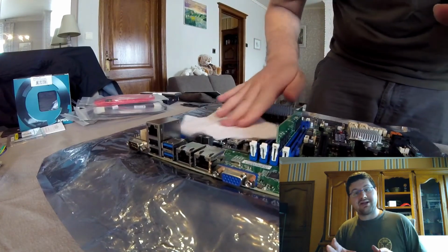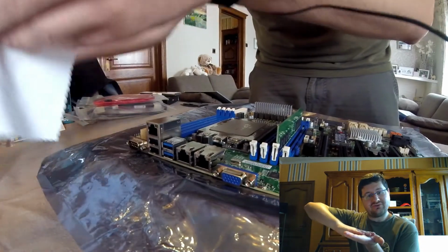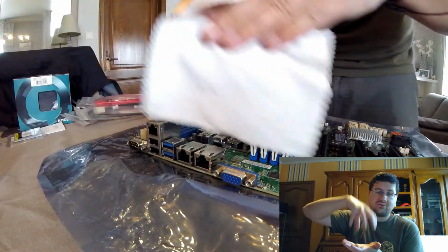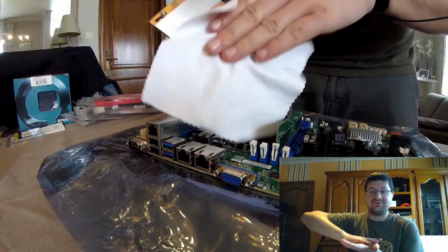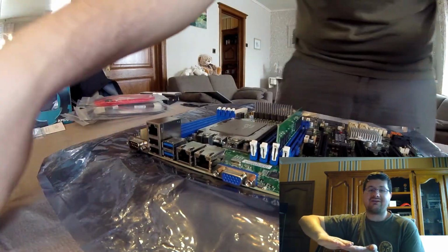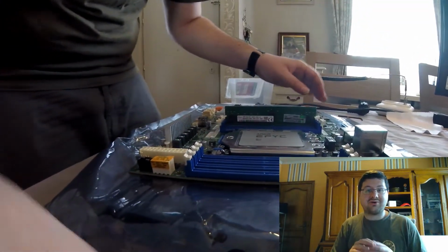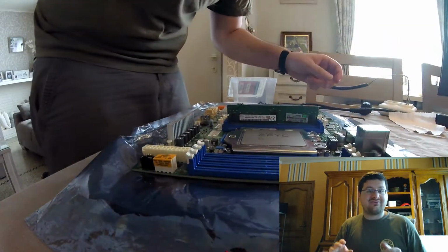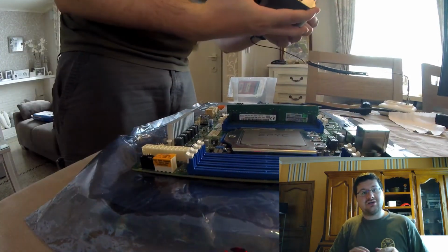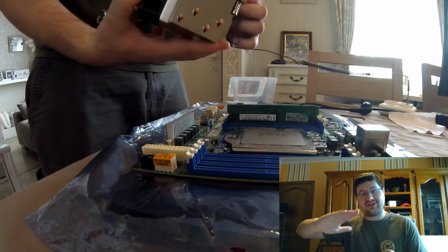And then I combined that with a cooling paste, because you need to get the surface area between your CPU and between the cooler that you put on top of it. There has to be extremely good contact. And a thermal paste, a very good one, will actually decrease the temperature of your CPU by sometimes up to 10 degrees centigrade compared to having a bad cooling paste. If you're not using any cooling paste at all, you're probably going to overheat your CPU. So it's very important that you have that on there.